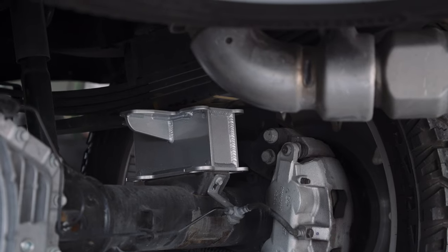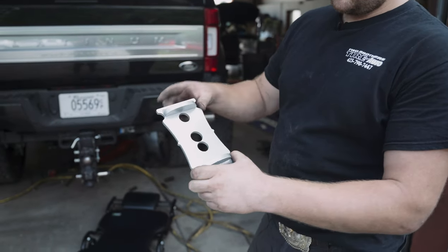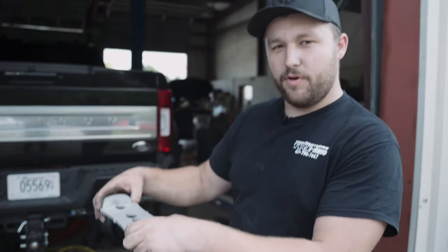So to go with that block movement that I just told you about with the different pinholes, this is your top piece that goes on top of the leaf springs, and these other holes on top of the centering pin account for that movement of the block. So we're gonna put it in this back one and account for it.